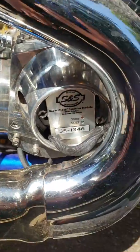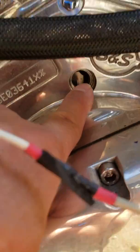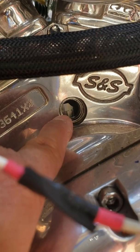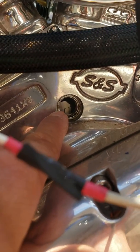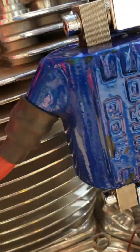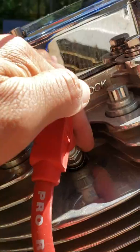Leave the bolts out once you inspect it and put it back in place. Take out your engine plug and right here you will be able to set top dead center. For an S&S motor, you'll get a T colon F — TF — which means top dead center.